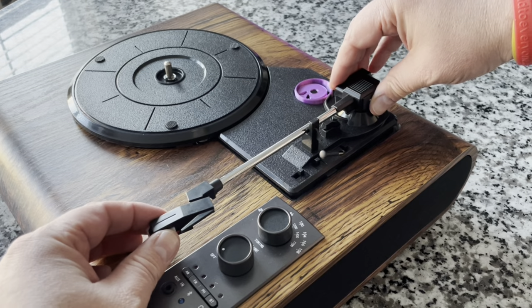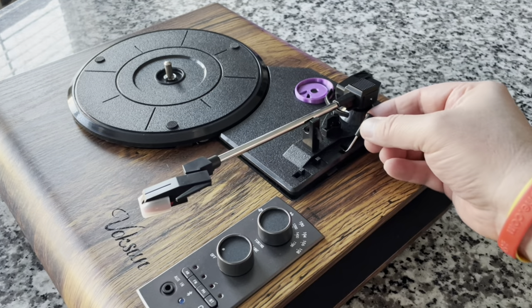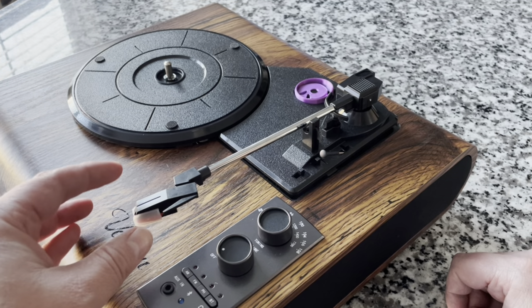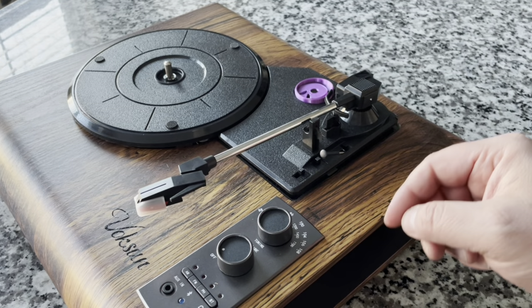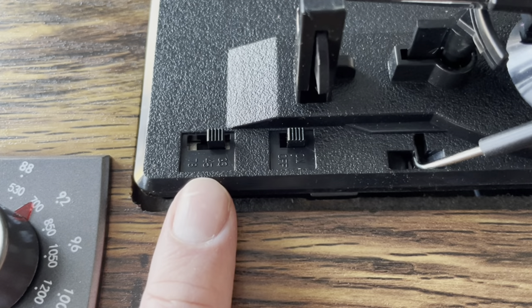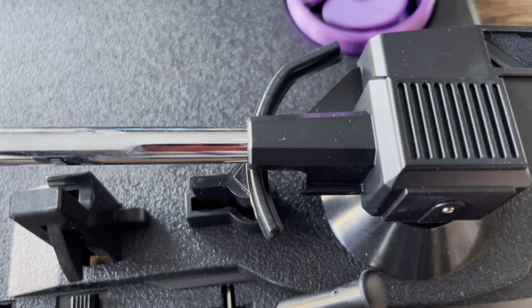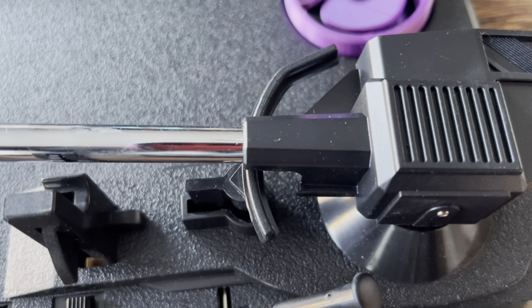This mechanism — the gimbal is loose like it normally is. It does have a lift shelf, a hard plastic lift shelf, and a tonearm lift. The descend is super slow which is good — it is definitely damped. It does want to kind of jump off to the side when you lift it up and down, but that's no huge deal. This does have an auto stop switch — press it to the on position and the record will stop rotating when it reaches the end of the record. This is the speed selector switch for the three-speed unit. The lift shelf has a sort of weird angled piece — it is rigid plastic, though I prefer the ones with rubber slightly.